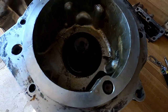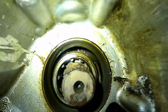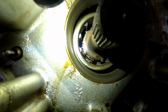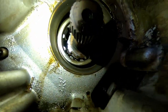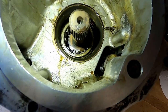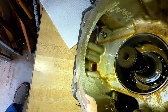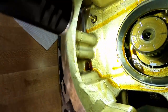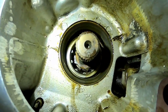While I was cleaning it I was finding metal chunks coming out of it — you can see metal chunks in there, there's a good one. I think this output bearing is just disintegrating. It's a good thing I didn't rush to put this on because now I'm going to have to put in a new bearing. I'm going to have to swap — put in a new bearing at least, if not swap out my old shaft as well. I think they're not the same, so it's just a bearing — I'm going to have to buy a bearing and figure out how that goes in.